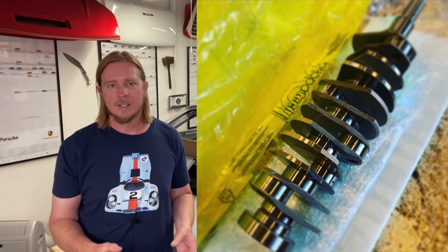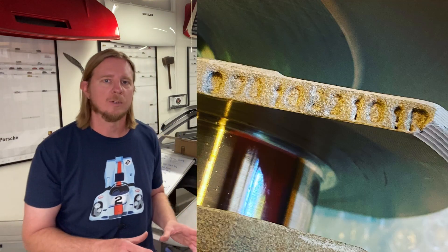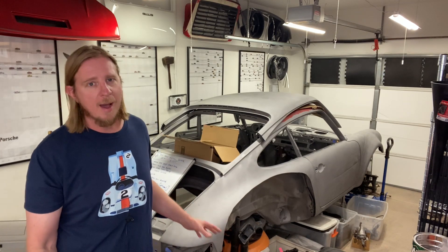The block is finished — it's at Ollie's ready to pick up, all prepped. I had it modified to fit a GT3 oil pump, which is on its way. I also have my bearings coming, and I sold the 3.2 crank featured in an earlier video and bought a 996 GT3 4.0 motorsport crank. This has an 80.4mm stroke, as opposed to a 74.4mm stroke on the Carrera motor. So the motor will be a stroked motor with bigger pistons, putting the displacement at about 3.55 liters. With the MFI pump on top of that, I think that's going to be awesome — plenty of power for this car, which should end up around 2,000 pounds.